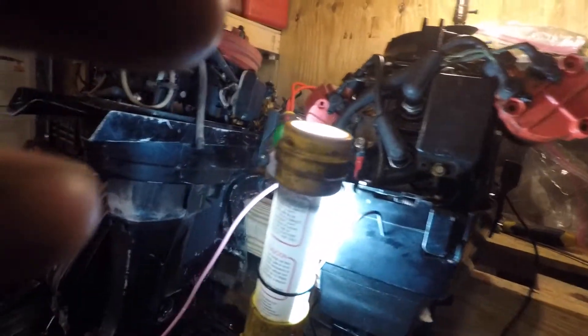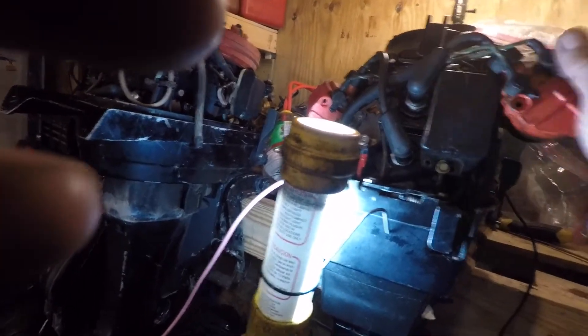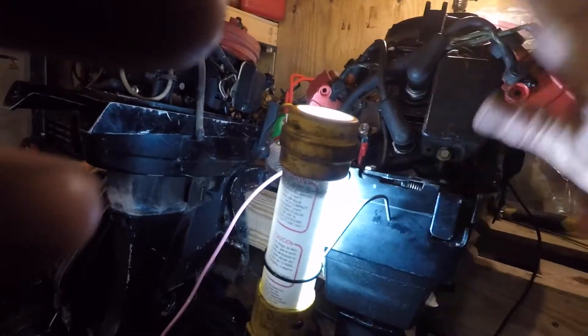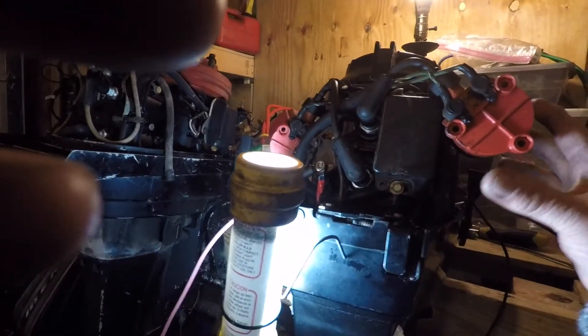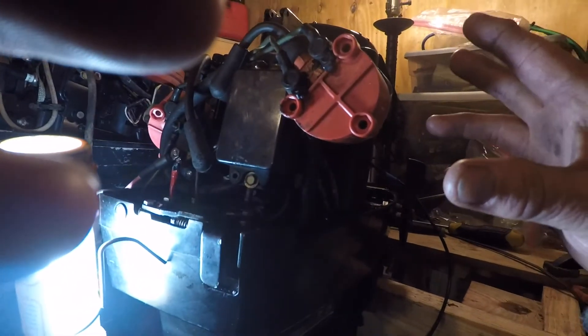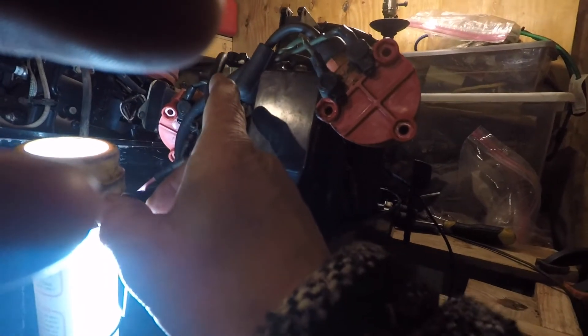This thing doesn't hardly take any juice - so the starter does turn now. I can put it in neutral and it does start now. So I'm going to put my coils back together, pop my spark plugs out, and put a compression tester in here. I've also got a tool that can show me spark. I'm going to hook that up so I can look at spark and then see what compression this has on the top cylinder.